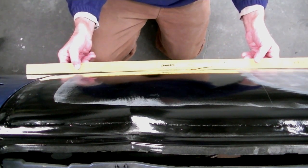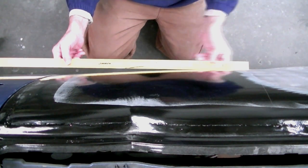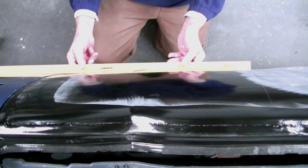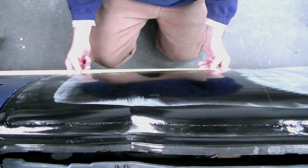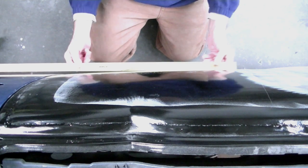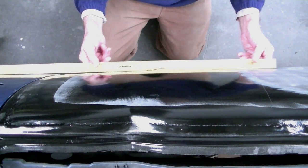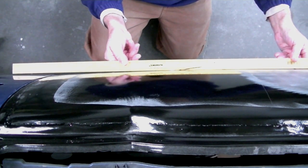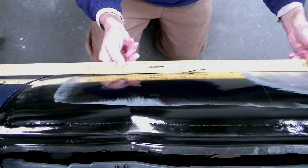Now the fact that you can see up on the top of the quarter panel, it's been welded across the top about 2 inches down, and it's been welded down the quarter panel near the door jamb, that may account for some of that gathering up of the metal and the expansion of it. In any event, we're going to have to shrink it and draw it in order to get the yardstick to lay flat with the door into the quarter panel, giving it a consistent contour.